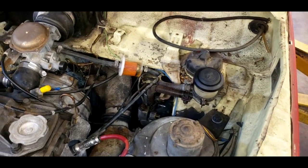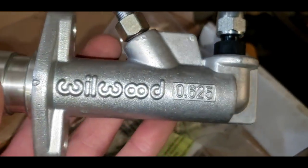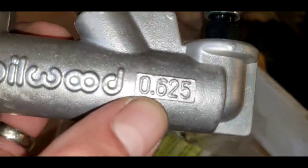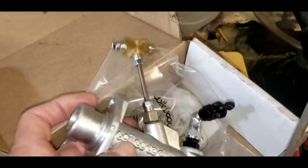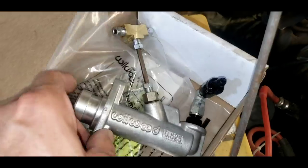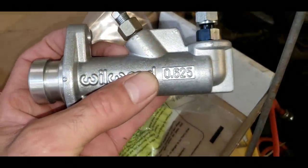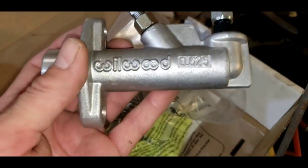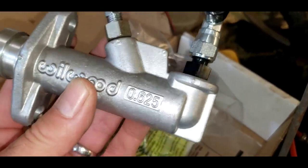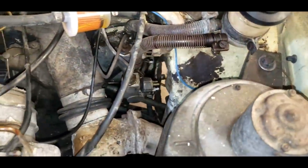In keeping with the theme of experimenting, I work on a lot of little micro cars and these little master cylinders made by Wilwood are street rod master cylinders. This one — you can see the size of the bore is stamped right on it. That's .625, that's 5/8 for us Americans. That's a small bore. These come in different sizes; you can get them down to a half inch, a 5/8, a 3/4, and maybe a 13/16. The reason I'm interested in converting this car to this master cylinder is it's short and small, and the bore is small — it's got to fit in that hole between a hot exhaust manifold and some heater ducting. I think this will do it.